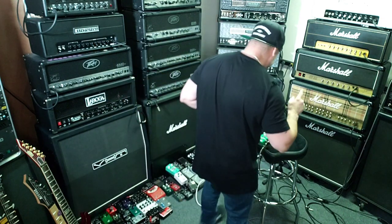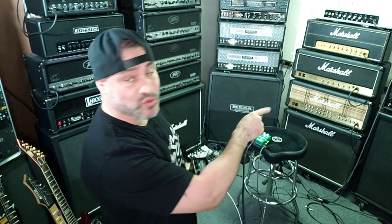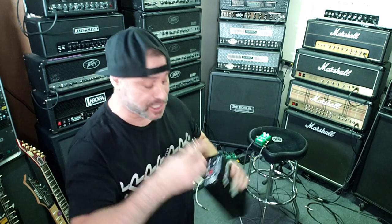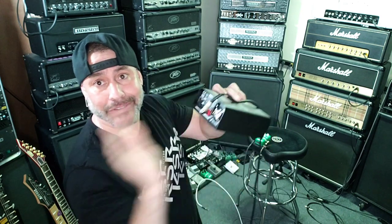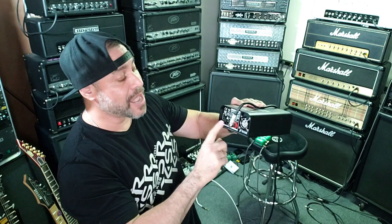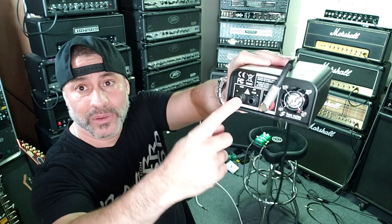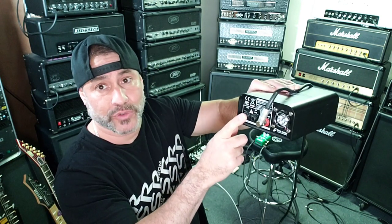In my case, I'm using my PV5150. That is running out from the back. This is the speaker cable for that. That goes into the red. That's all you have to remember. Into the red. Head into red. Done. Now you have the throughput, which means if you're using an amp that's 100 watt and you want it to remain 100 watt, you just run it through the through.